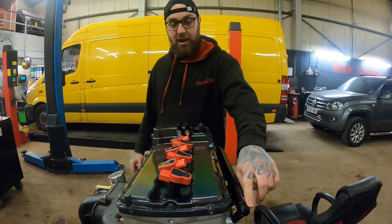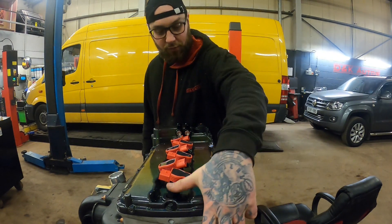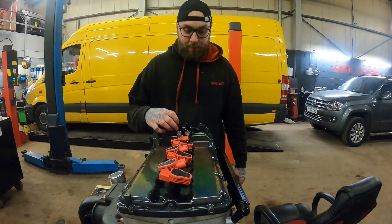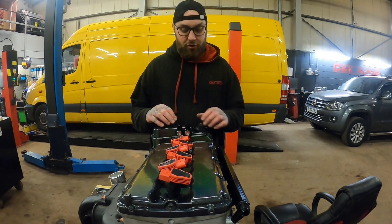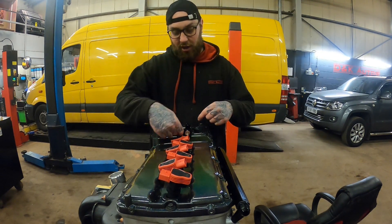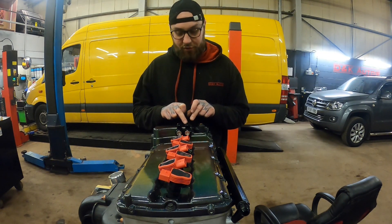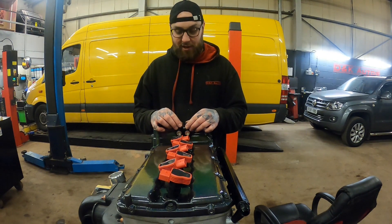So I've now got the swivel banjo fittings instead of the straight ones — the straight ones will go on the fuel line. I've got the baffle in, both nuts on the back, and actually welded between the nuts so they can't come undone — they'll fight each other to loosen. That also means I can tighten the fittings without needing a spanner on the other side. With the dowty washers on as well, hopefully they won't leak.